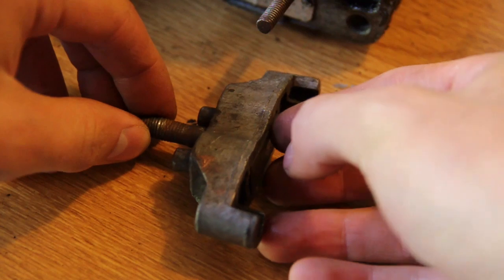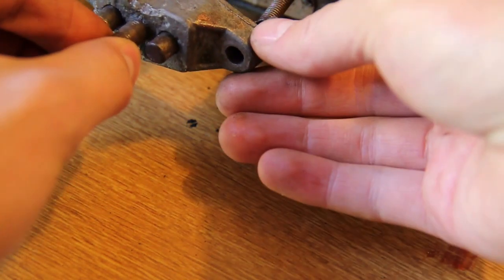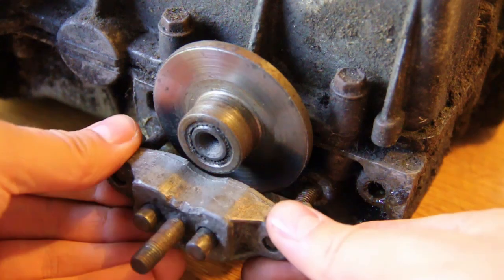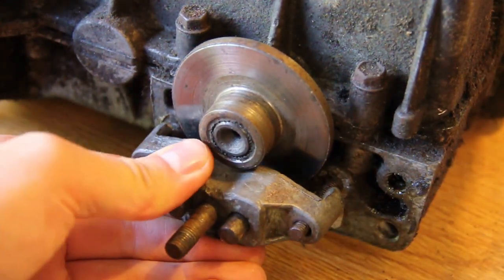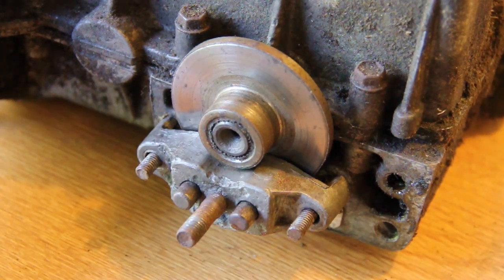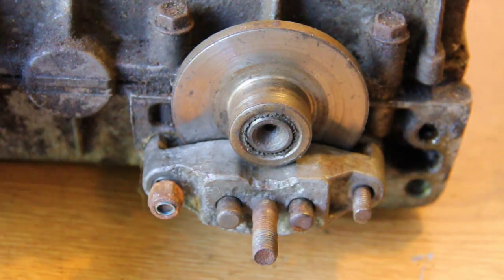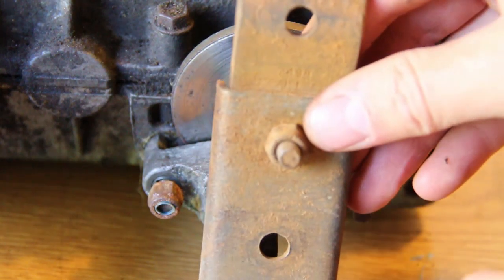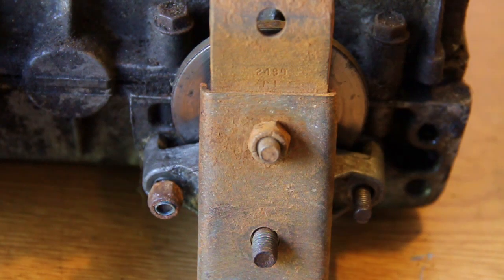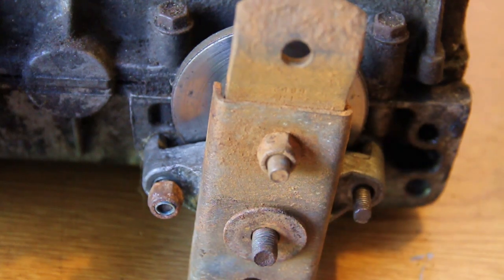Now we can build the caliper up. We've already put the metal plate in. The second brake pad can then slot in and carefully you can put that back on and push it on. Sometimes it can be quite hard to get on and off because it's a bit stiff. Once it's on, put the locking nuts back on — make sure you do this in the right order. You need to put that plate on with the lever, so the washer goes on first.